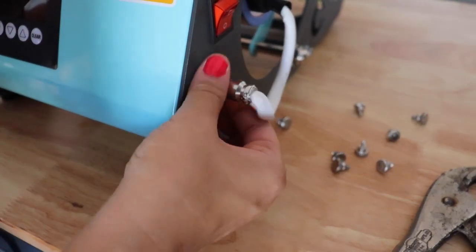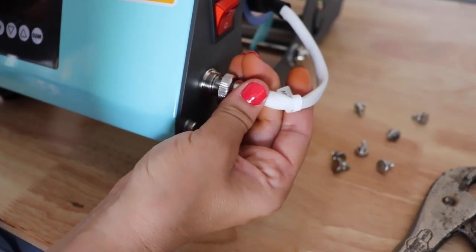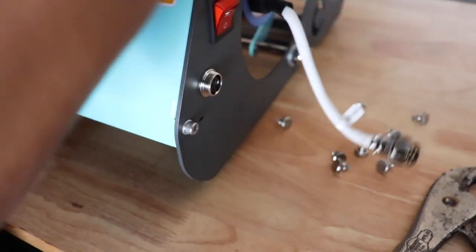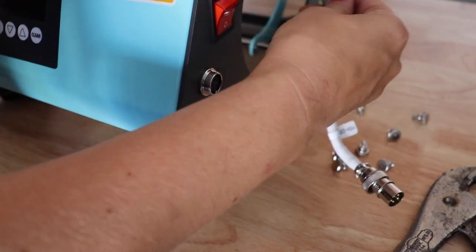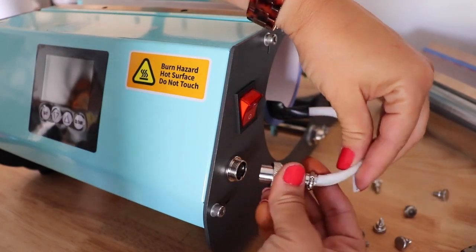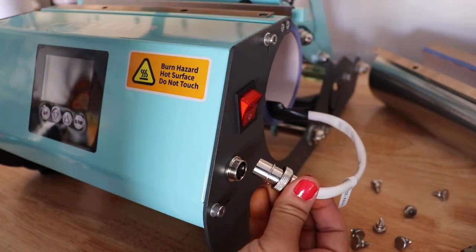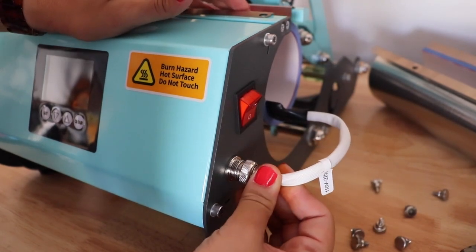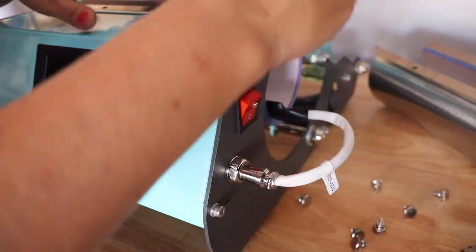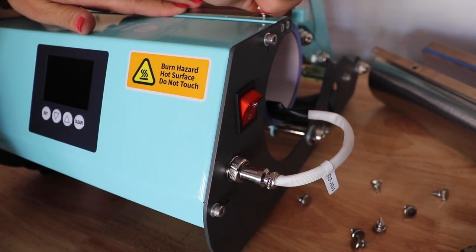The final thing to remove the sleeve is to unscrew the part that connects the sleeve into the machine itself — unscrew it and gently pull it out. Those prongs are in there, so take it off the machine carefully. To put the new sleeve on, start the same way: put the new sleeve in, connect the white cord with the prongs — it has a flat end so you'll know which way it goes — then use all the little screws to attach it back onto the machine.